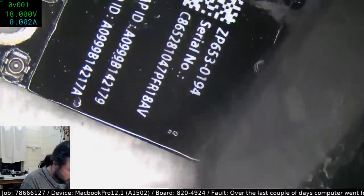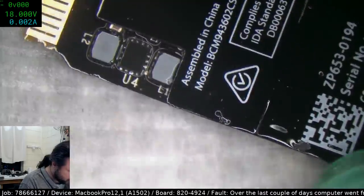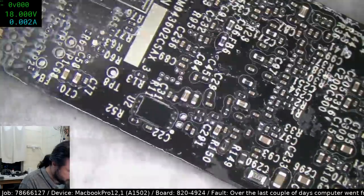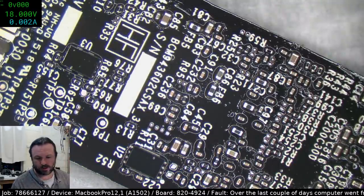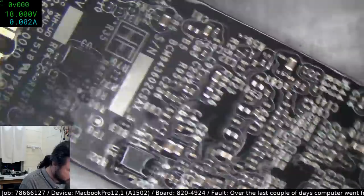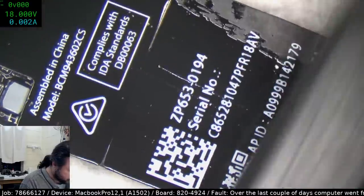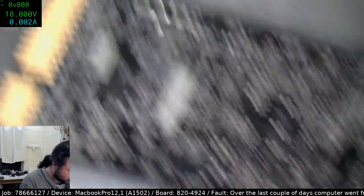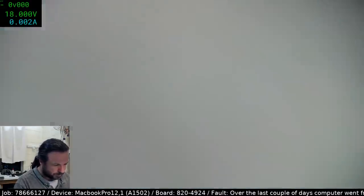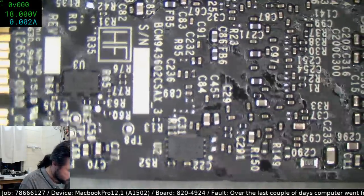My drying oven is a pizza oven, a 19-inch pizza oven, I think it was. It's a decent-sized pizza oven. Then I just created my own little temperature controller unit for the outside of it. It uses PT1000 elements rather than thermocouples. I just always prefer them over a thermocouple. Easier to interface with. I consider that to be more dependable overall as a complete system, especially for the temperature ranges that I'm working in.